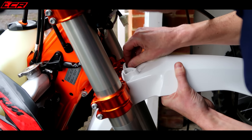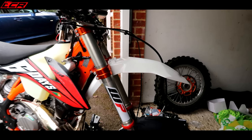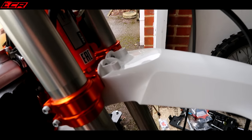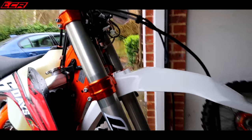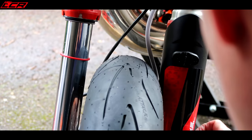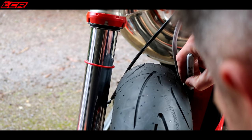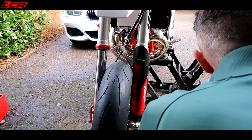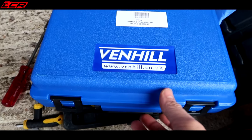This is what it's all about — doing jobs in England in a bit of rain! Mudguard fitted — that is the FS 450 mudguard, or the 701 mudguard, it's the same thing. All of the bottom yoke is the same fitting so all the same mounting holes — just bolts straight on. We're going to trim the fork guards now — it's about there, isn't it. Trimmed — beautiful! Break out the Vampire bleeder.